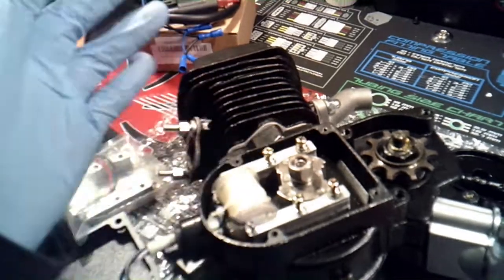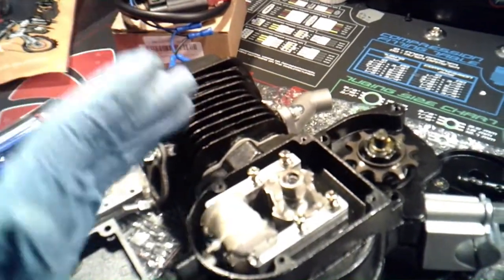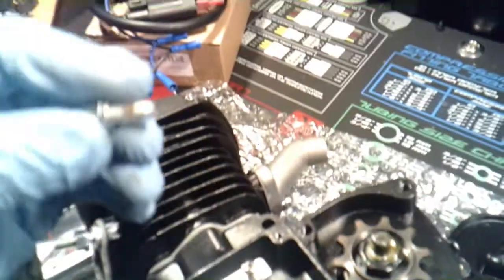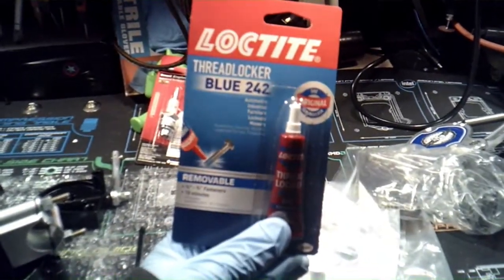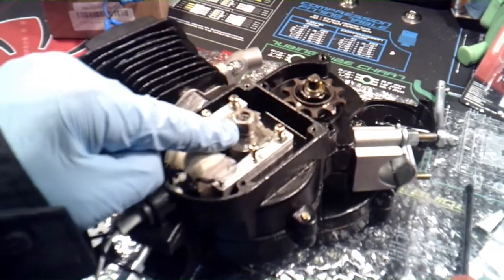That's a good example of why you need to take these motors apart and check them. The heads aren't torqued down evenly — one's looser than the other. I was looking at this back here and when I started to turn the nut, I realized I wasn't actually turning the nut — the thread itself was coming out of the block. There's just all kinds of little things you have to check and double-check, and that is the reason why I got a brand new thing of blue Loctite. I'm going to go ahead and take out the magneto and tighten that nut down.